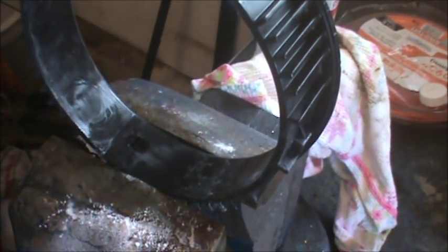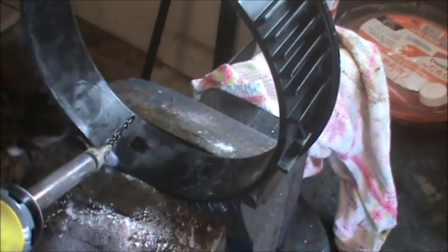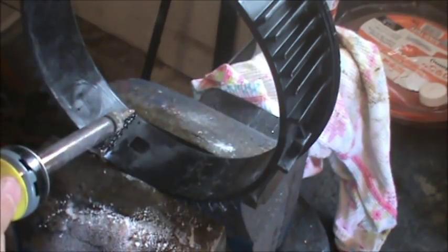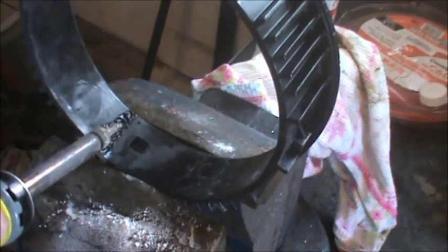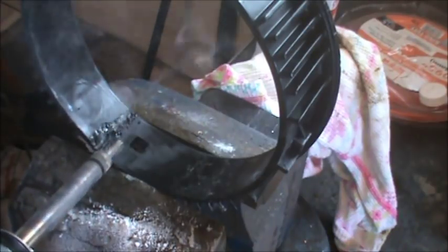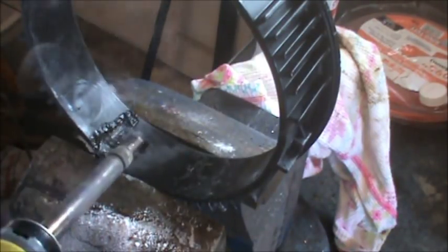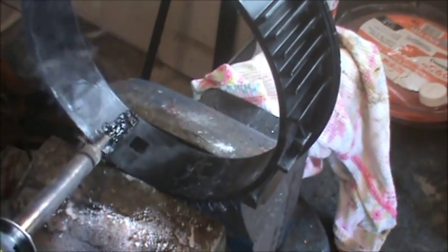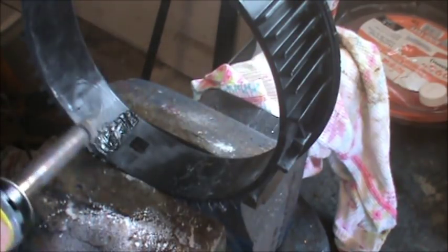Now I'm going to be using my soldering iron at full heat and I'm applying it right to that crack. You can see how it draws right through the plastic like that. Then what I want to do is come back and scrape plastic into that ditch. If it's a little bit rough when I'm done, I'm going to come back and grind it off with either sandpaper or something else. I'm breathing in some of this burned plastic — it's harsh. I'm packing up this molten plastic and just filling in that crack.